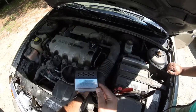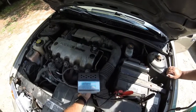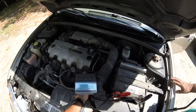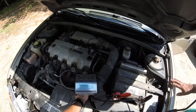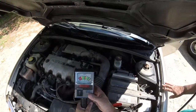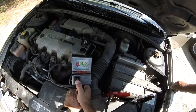Connect clamps to battery terminal. Battery must be at least 75% charge — it is. I had it on charge for two days, so I know it's fully charged. Locate the symbol on the meter with that little arrow. Press the load switch. After 10 seconds, read the meter with load on. Let's put a load on it and count to 10. 1 Mississippi...